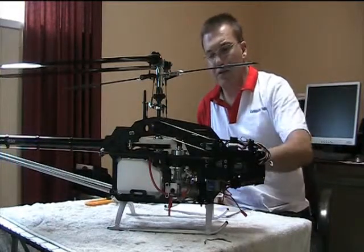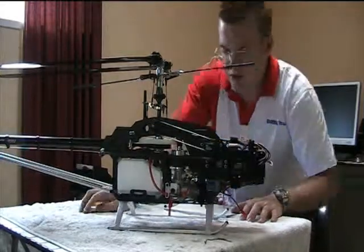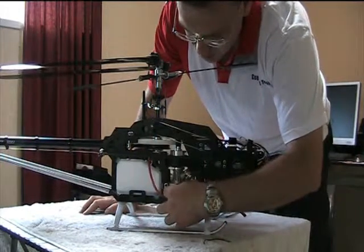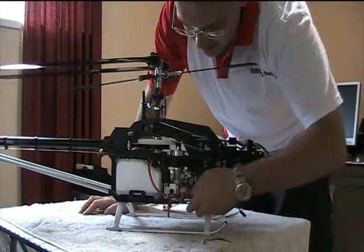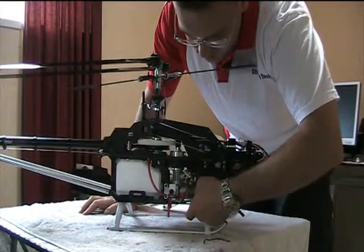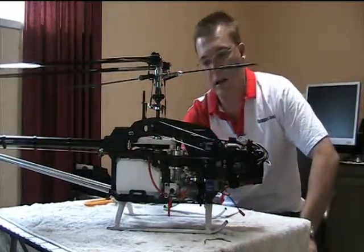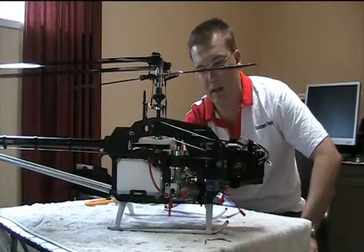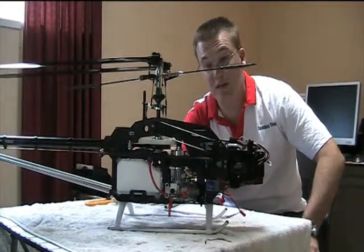That's the way I'm going. The other thing that I need to touch on that I didn't in the previous section is the engine screws in the soft mounting system, these small screws that go straight through it. The dampening system is actually a two-piece mounting system with a bolt holding those two pieces together with a urethane dampener in the middle. Now, the urethane dampening is actually very soft on the 3D Plus, and if you move the engine, it can move a good 3 or 4 millimeters side to side. It remains to be seen whether that causes alignment issues in the clutch stack and the clutch bell up against the pinion, if it causes excessive wear by rocking that clutch bell and pinion back and forth with the amount of flex that the soft mounting system allows.